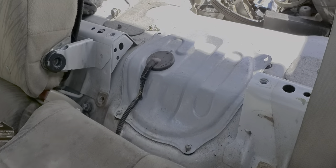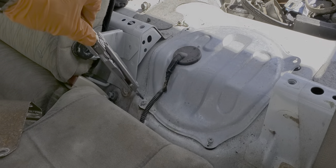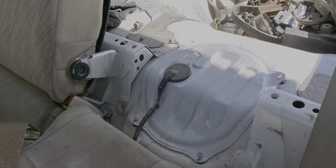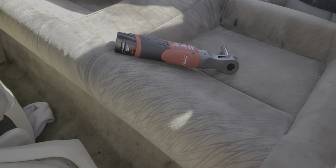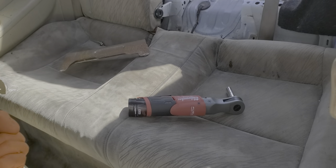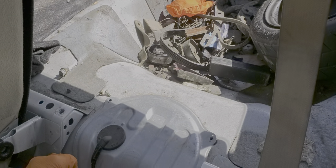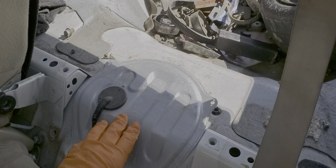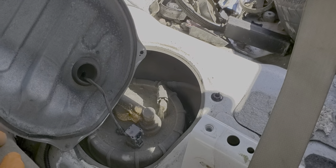With the bracket up, we're almost there. We've just got two more Phillips screws. You don't have to remove the bottom part of the seat, although if you want to, you can — just grab the bottom here and pull up on either side and pull it out. With all the screws removed, this cover will sometimes be on there pretty good and you may have to pry it out, but this one's been removed before so it just comes up easily. That's going to expose the fuel pump.